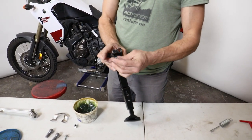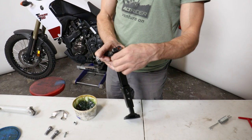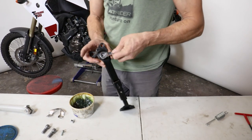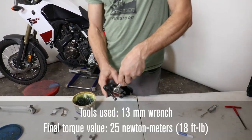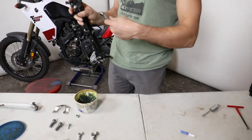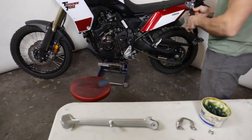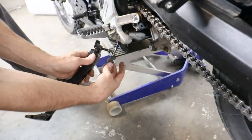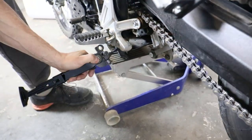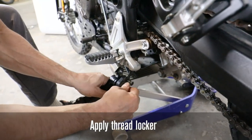Get everything finger tight, then go over to the bike and put the switch on — whether you elect to run the switch or not, I'll show it getting reassembled. It's 13mm on the back — snug the assembly up and torque it, or torque it when it's on the bike. Over at the motorcycle, catch the assembly onto the peg, get that little pawl into the receiver, grab the small 10mm Allen bolt, and drive it into the pivot bolt.